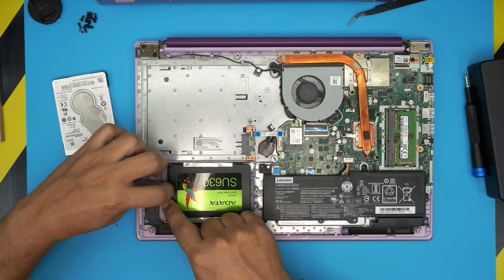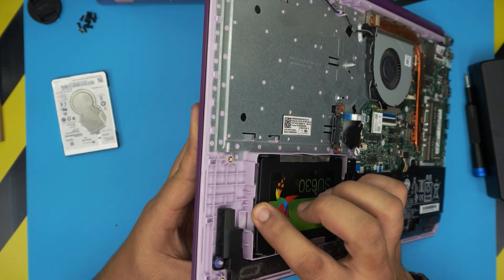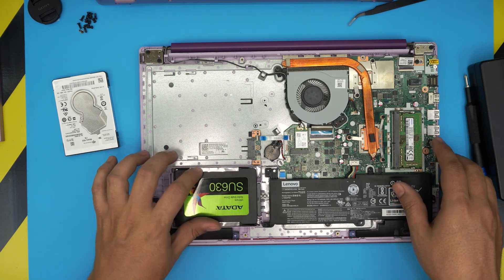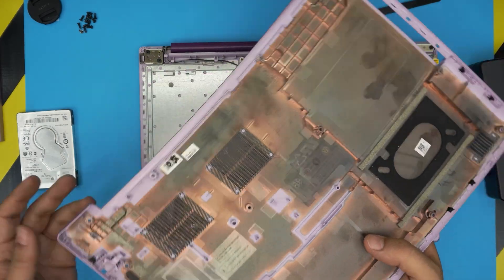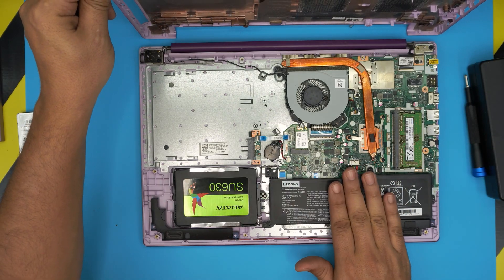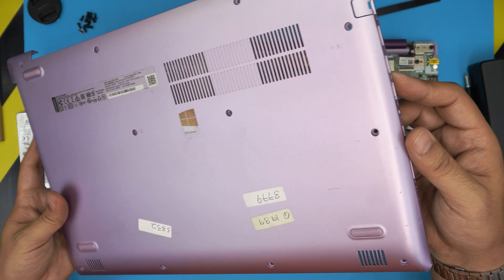Find your way to push the drive in and make sure it clicks into place, then push it toward the case. The clip may not hold it down, but there's a little sponge inside that holds it in place, so it's fine. Once you're done with that, you don't need to disconnect the battery at all to do this upgrade.